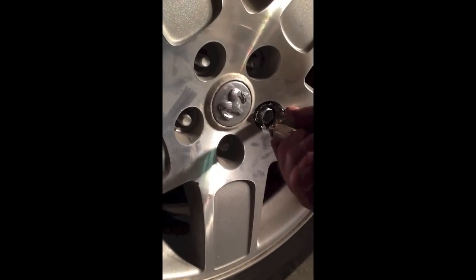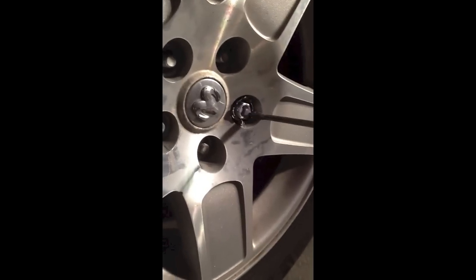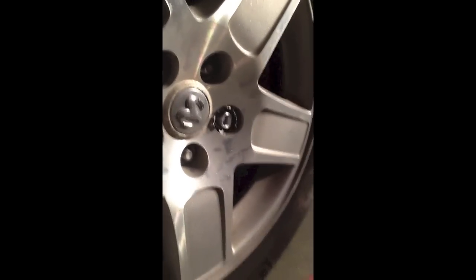Pull the aluminum away and pry until you clear the bolt and have all metal bolt exposed. Grab onto the outside edge and work it around until you get enough of the outside edge loosened up that it will slip off. Be very careful — if you slip, it will damage your aluminum wheel. The aluminum wheel is very soft. There we are — this one came right off.